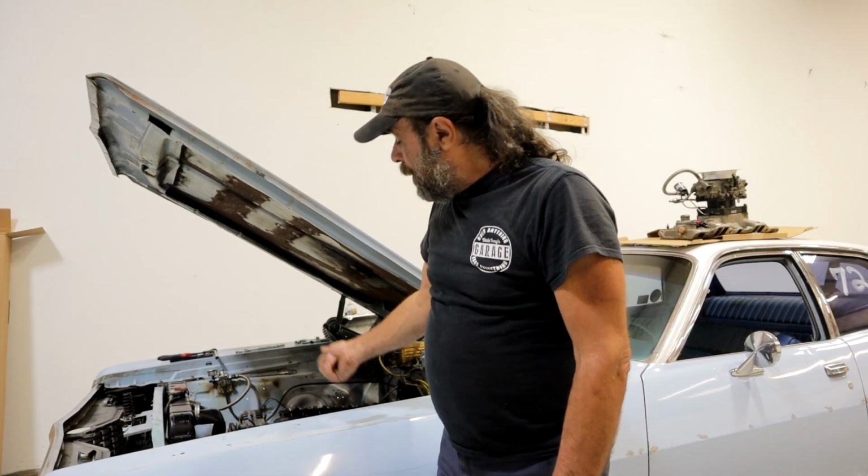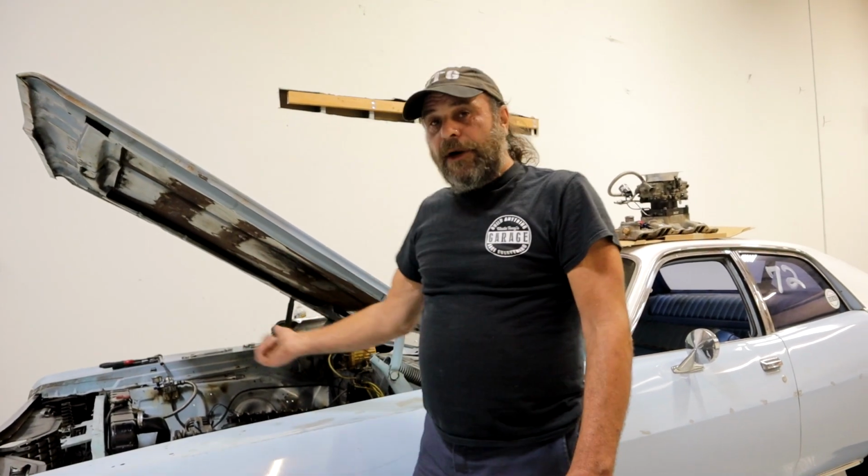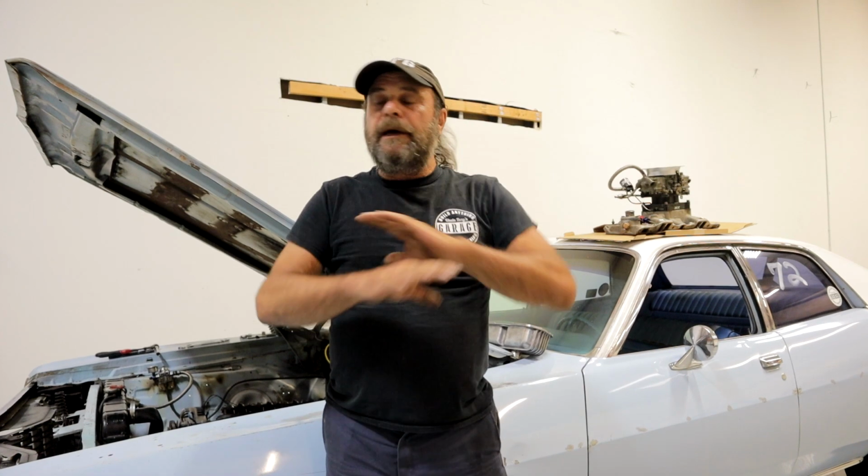I have several brand new rollers in here that just bleed down after 10 minutes. There's nobody home. I start the engine, oil pressure comes up, lifter noise goes away, and the engine doesn't show any signs of having collapsed lifters or not enough lift or anything like that. Forget about audible. If you were deaf, you still wouldn't notice any difference in the way the engine runs. The engine runs perfect. But why are these things bleeding down, and in such a short period of time?